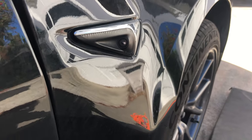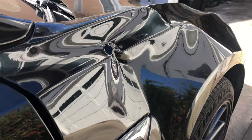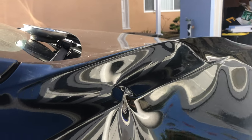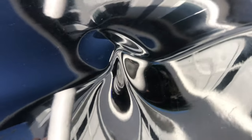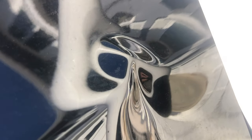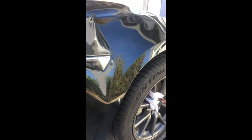Sprayed clear coat does not reach the hardness level of factory clear coat, and that's why factory paint doesn't crack when impacted, moved around, and bent this way. That's what's so amazing about factory paint — that's why you want to keep it. My experience with dents like this is that it's displacement, not a stretch. The metal basically moved up a little and is frozen there. These panels are very strong and can recover as long as you apply the right pressure in both directions to bring it out and give it strength again.